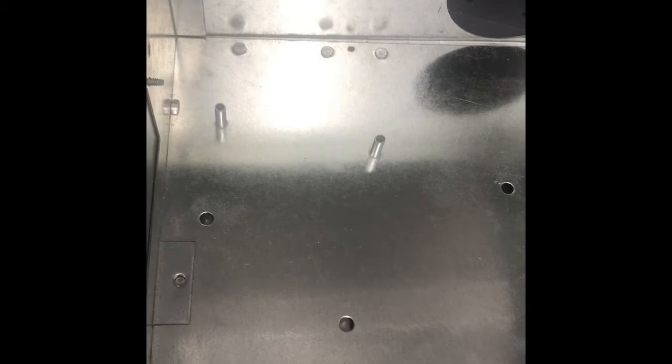The Boondocker didn't match any of the existing mounting holes for the circuit board for the old Parallax. So I'm going to take a small Dremel tool and flatten these little extruding metal supports for the circuit board for the Parallax. I'll Dremel those off. We'll have a nice flat chassis, and then I'll mount the Boondocker to the bottom chassis plate using some sheet screws.